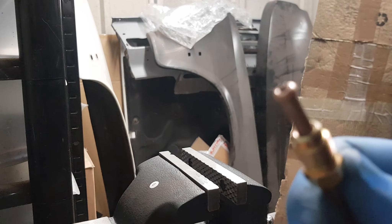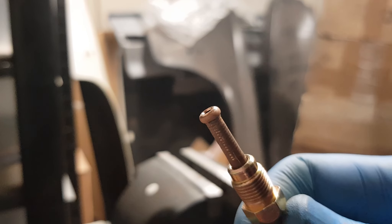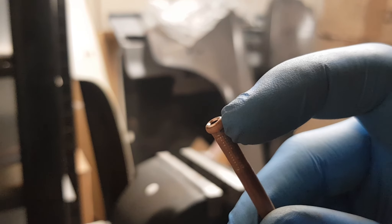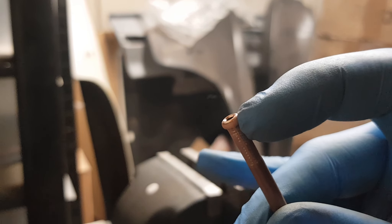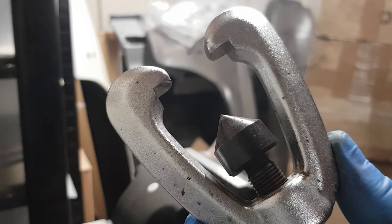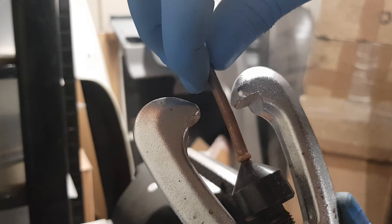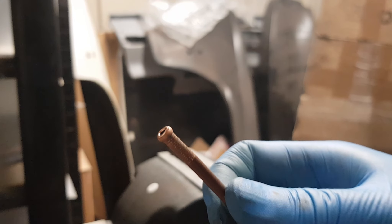You can also get what's called a double flare. This is your single male — a double flare has another indent right in the point. When it was in the device and clamped up, you simply go back in with this die again, and that's how you would create that second indent in it to get your male double flare.